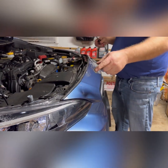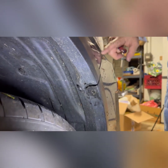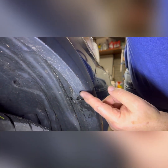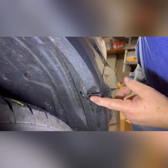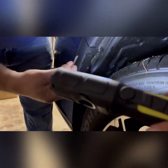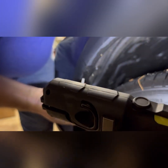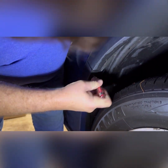Now we go to the sides. The next step: right under the wheel well there's a push clip. The easiest way to do it is just take a small screwdriver and push it into the little dot in the center.